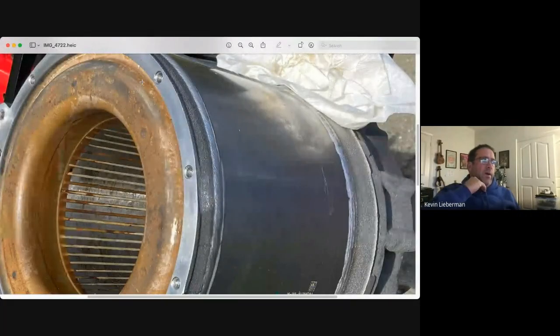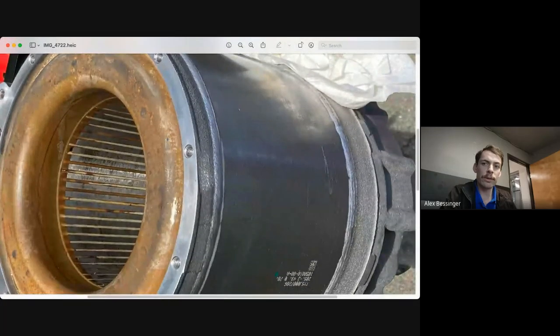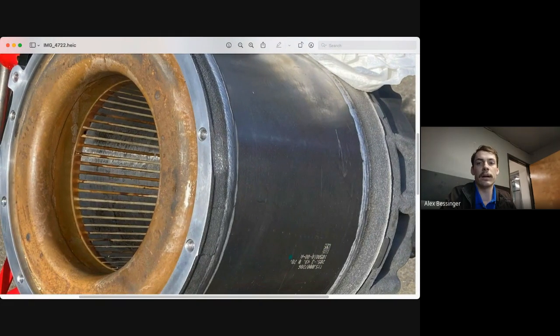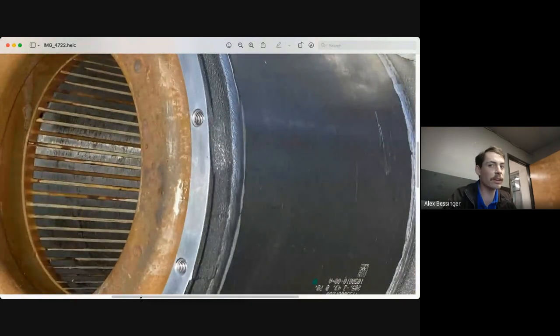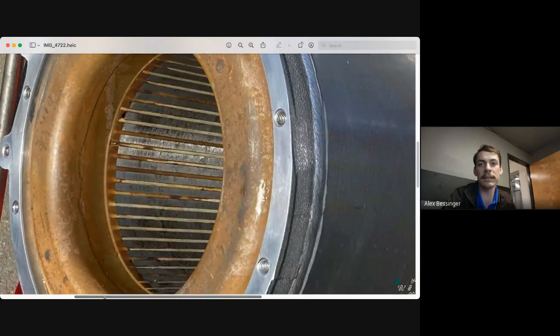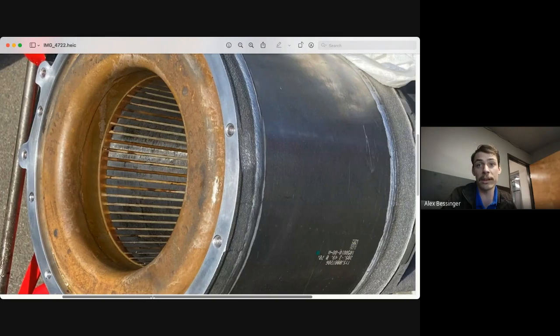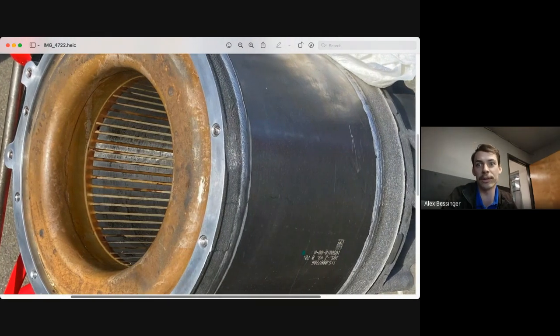What's the symptom on your car if those have gone bad or are going bad? They can have a few different symptoms. More often than not, though, you'll just end up having a situation where the car won't start. Sometimes they'll get to a point where they can maybe still start the car intermittently, or in the case of a lot of Model S's, when the contactors start to go bad, you'll get a power level reduced. So the car won't deliver as much power anymore because it's measuring the amount of resistance in those contactors, and it can actually measure how large a difference in resistance there is, and it limits the power so that they don't heat up and actually weld the contactors.